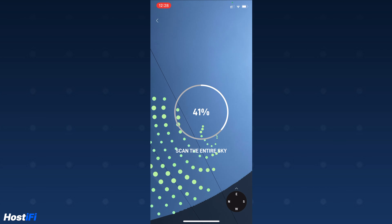Running one more test — it ramps up really quickly, hitting 200–203 Mbps on Wi-Fi. We have a video coming soon that will cover how to set up Starlink with Unifi. You can put the Starlink dish into what's called bypass mode, which disables the routing functionality of the Starlink router and disables the NAT. You won't get a fully public IP address, but you'll get a carrier-grade NAT IP address from Starlink, and you can plug that straight into a Unifi network.